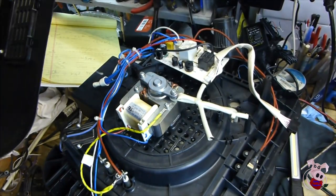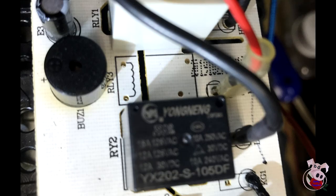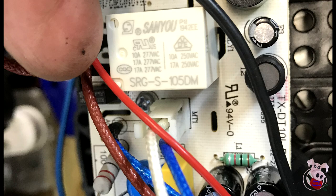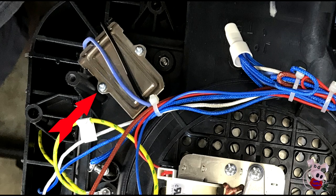Take some pictures of this layout in case you need it for reference. Once you get the cover off, take a moment to inspect the relay board. It should have no evidence of damage, no burn marks, no discoloration — it should look clean and pristine. Look closely at the relays; they should have no burn marks or heat discoloration, which would be an indicator of a relay problem. At this point, if you're replacing your light bulb, you should have free access to the two screws closing the light bulb compartment.